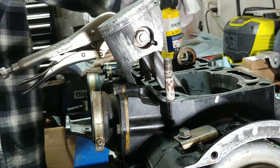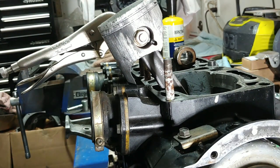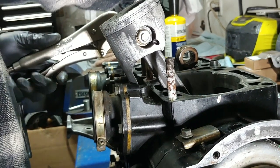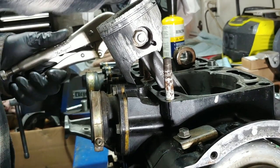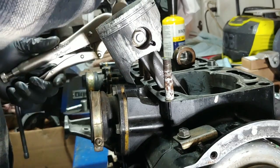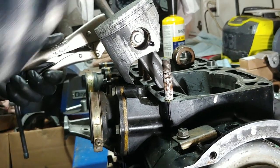You can hear it - not popping but there were little tink tink noises. I'm going to put some eye protection on because you just never know what's going to happen here. And then you just crank it - it's a slow process especially when they're seized up in here like this. But they come out, you just got to have some patience and know-how. At first it was pretty hard when I started cranking but then I heated it up and it loosened up - it's actually getting pretty loose now.